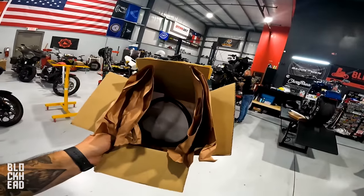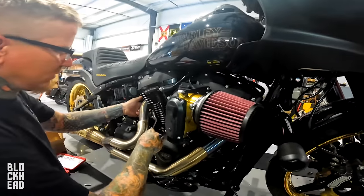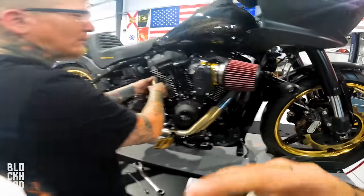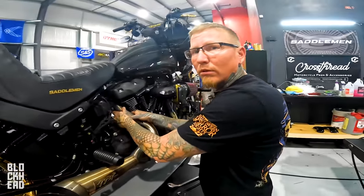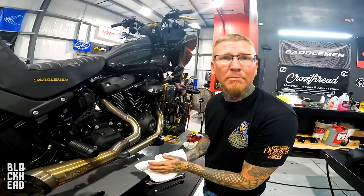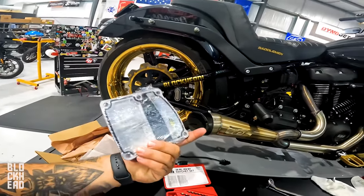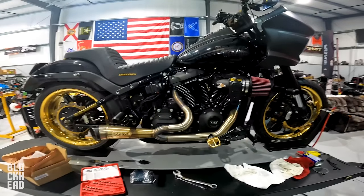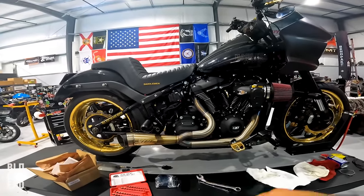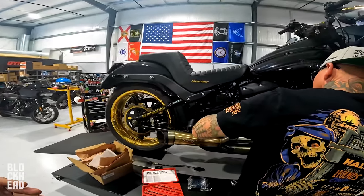The bike ran out of gas so we grabbed more gas, and we're also going to throw a Trask top cover on it. With this new intake we are now externally venting it instead of venting into the transmission top cover like we did previously. We've got vents going there and there. I've been seeing this a lot lately with M8s doing stage twos — having some pressure issues especially at the breathers. Since we do have the breathers open and venting externally we're going to go ahead and throw this on there to make sure pressures are all good, then continue tuning.